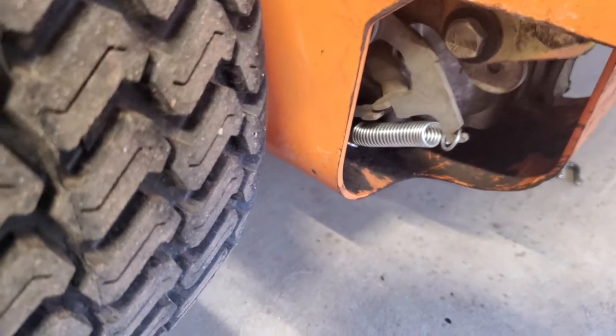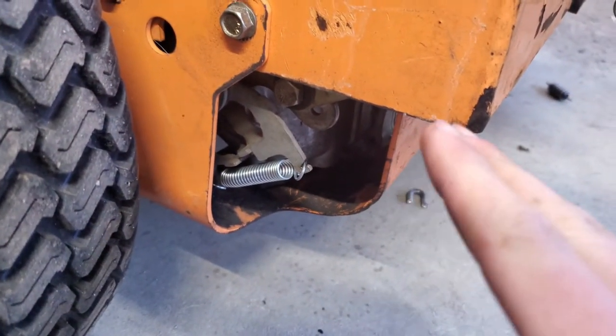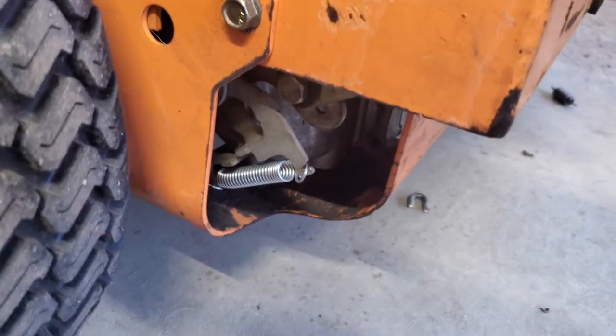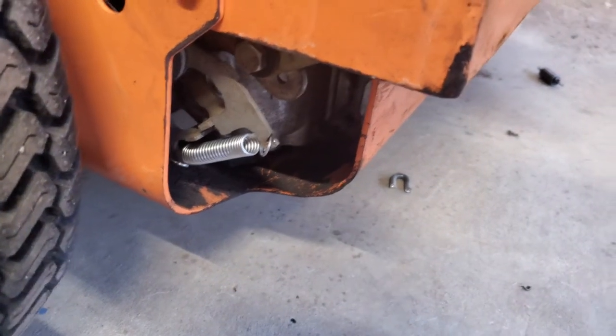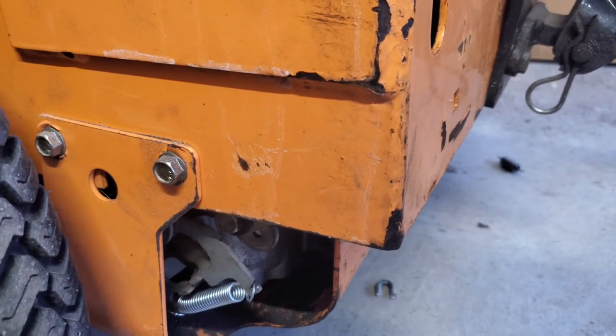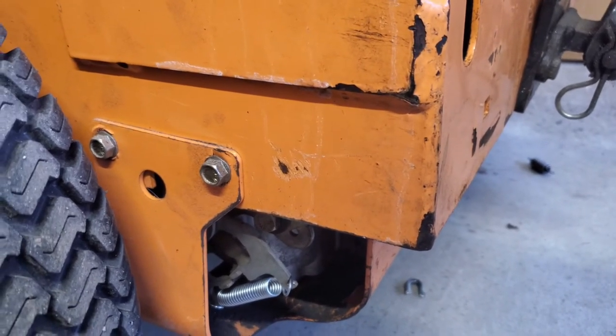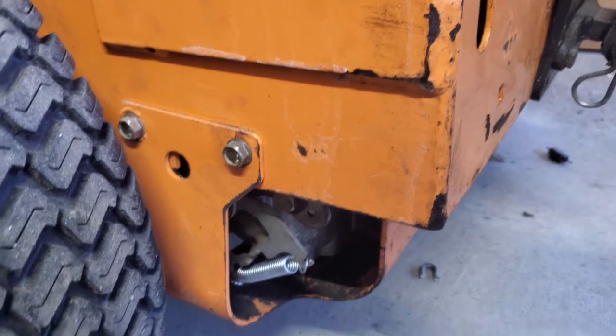The other comments I got were that they really put those on there so that when you're driving over bumps and stuff, the small vibrations of this lever with the hydro don't cause it to wear out prematurely. So the heavier the spring is, the less of those you're going to have. He said you can pretty much use a lighter spring as long as you can go on a hill and put it on neutral and it doesn't roll.